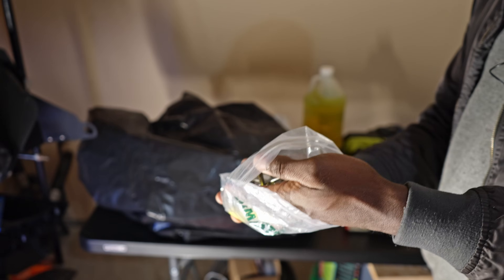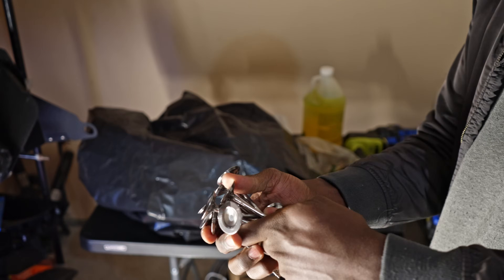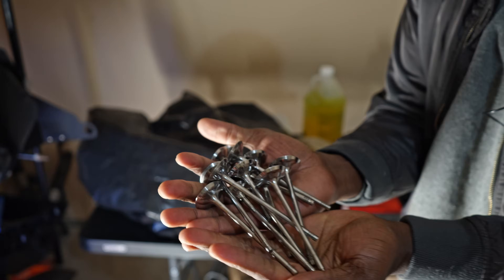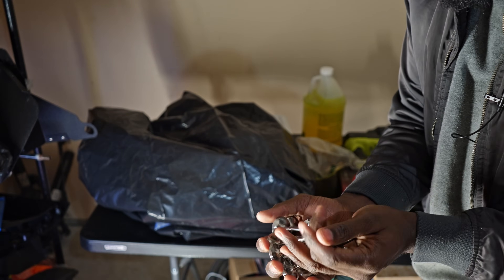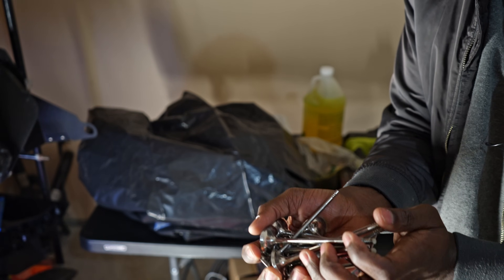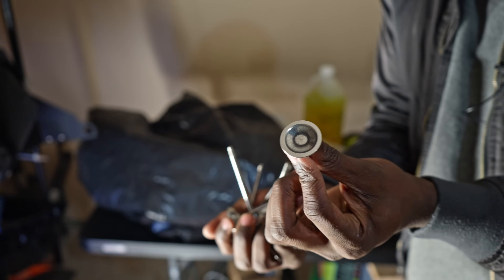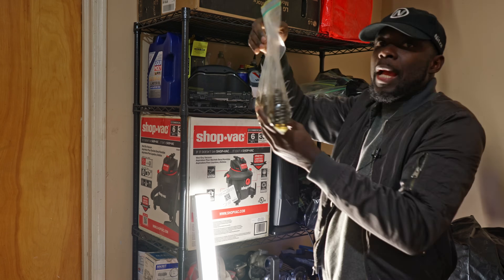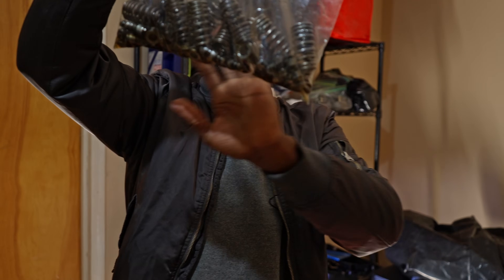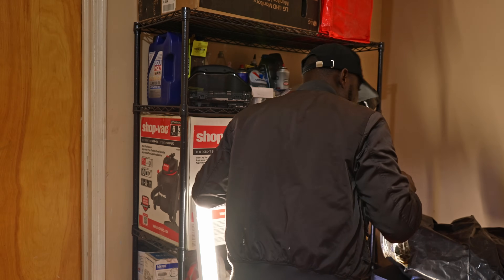Some things I am going to reuse are these valves — all 16 of them. I cleaned them out very nicely and they came out just like new. When cleaning them you don't want to damage or remove any material, just clean off the carbon buildup. I used a combination of things including a heavy-duty degreaser. I also cleaned the springs and submerged them in engine oil so they don't rust.